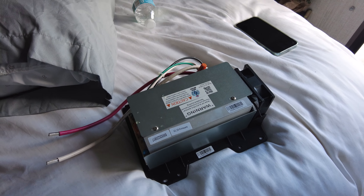Now, for those of you out there going 'holy crap, I just did this, did I mess up also?' — it's not a matter of starting a fire, because your charging unit's not strong enough. It's just that it's not going to be able to get the battery to its top — it'll only get it part of the way there. So what I had to do was find the component in my rig that is auto-detecting and will change to lithium-ion.